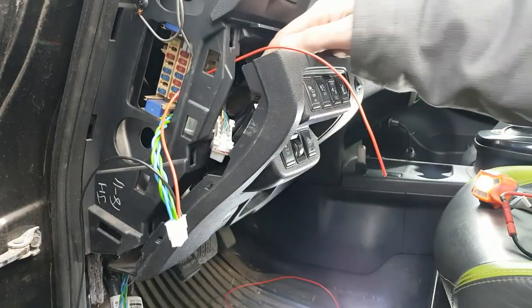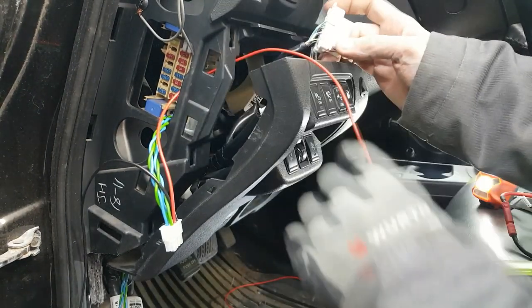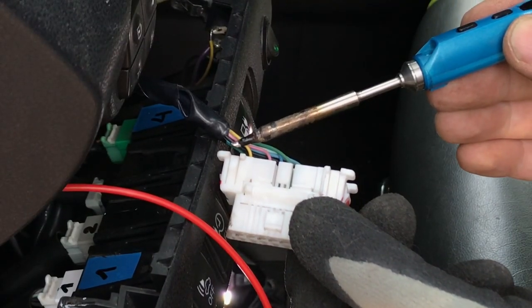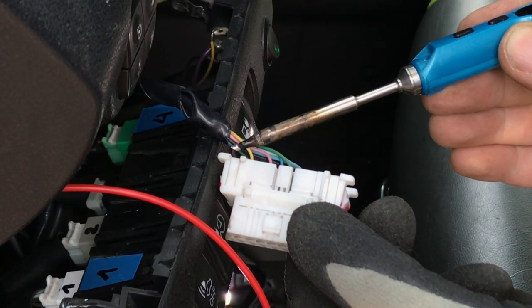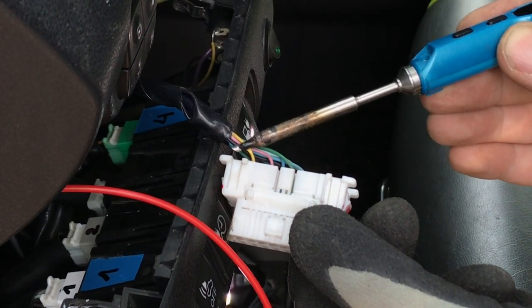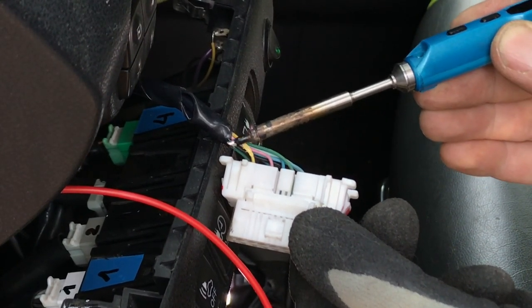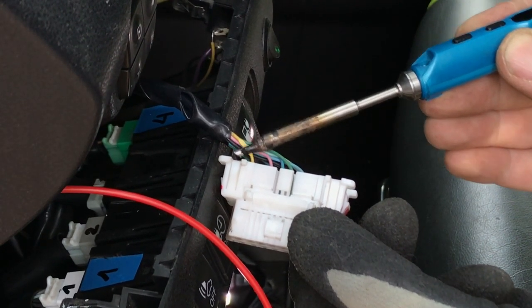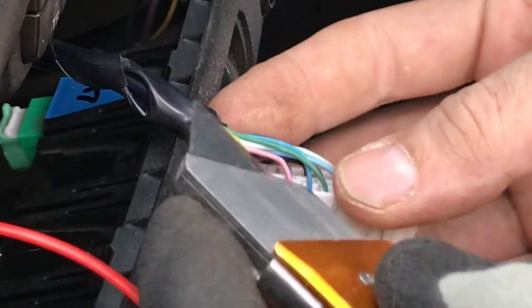Now pull the 12 volt lead up so you can connect it to the OBD2 yellow constant 12 volt lead, that one. Here, while watching me doing the soldering thing, I tell you what the CAN bridge does. CAN bridge acts as a man in the middle, like playing a phone with your friends in a stupid wedding party game. Somebody whispers something to you and you whisper it forward. This whispering goes both ways through CAN bridge with less errors than in the wedding party game.